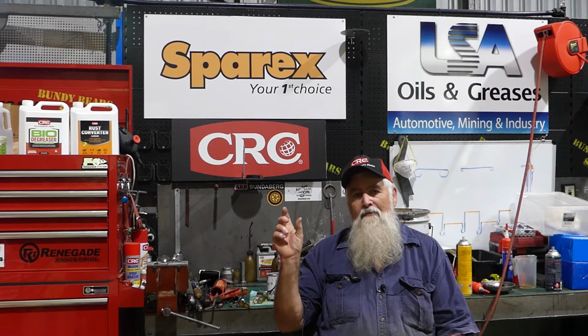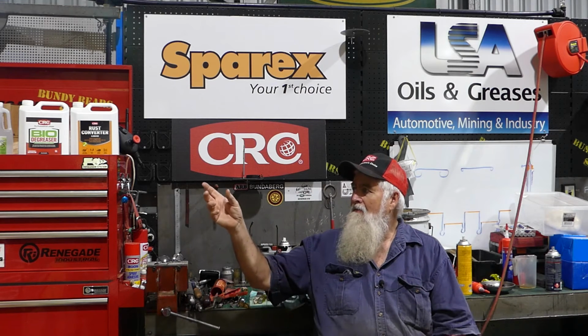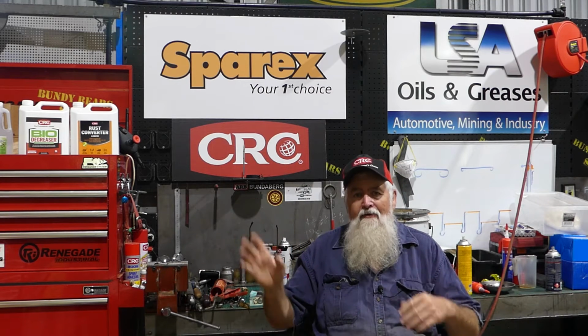And by putting the 50 millimetre axle in the boat trailer, well, the same U-bolt goes around the axle down to the fish plates, and the same U-bolts go around the suspension and everything. So with two fish plates, front and rear each side, we've got 8 U-bolts and 4 spare fish plates. You probably never use them, but if one of the U-bolts on the main suspension breaks, instead of the axle moving backwards and going all skew and probably being dangerous, I think we've caught that up.